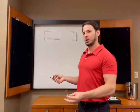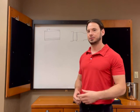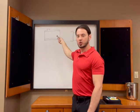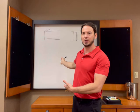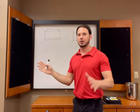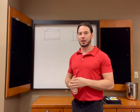Well, what are we gonna do? Remember that the fluid is designed to operate at the same temperature that the engine is, right? So we've got the engine radiator over here, and we've got engine coolant in here that's going to be, or if we just started, will shortly be at the temperature that we want the automatic transmission fluid to be. What are we gonna do? We're gonna take the automatic transmission fluid and put it over here with the coolant so that they can exchange heat between one another, whichever way is necessary, so that their temperature can become equalized.